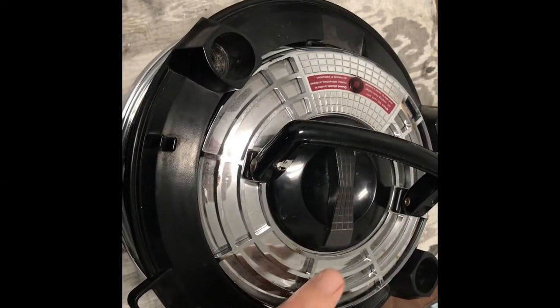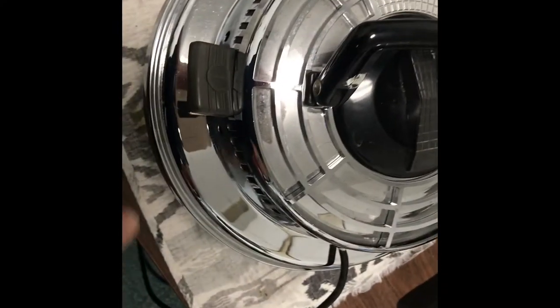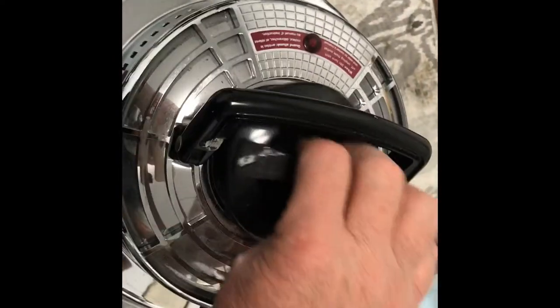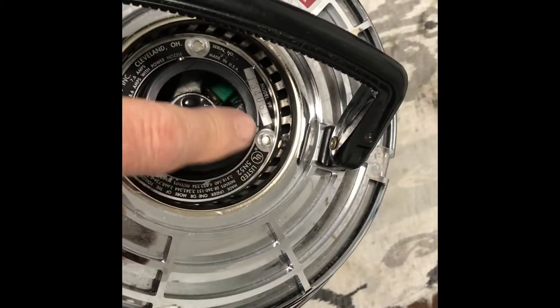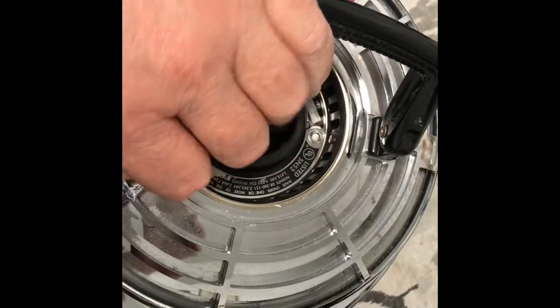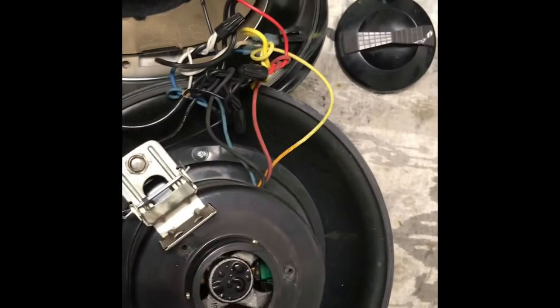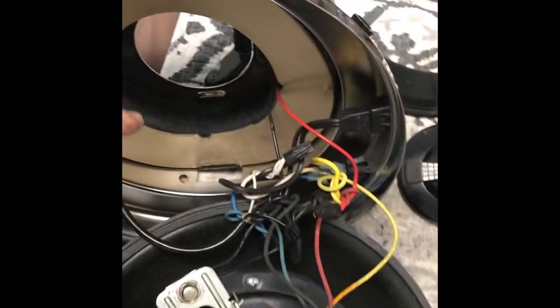What we're going to do with this 95X is take the tool caddy off and change the motor. You have to take the foot pedal pad off because we have to slide that through the housing. Take off the cap on the top — there are three screws in there that hold this together. I've already taken the screws out to save time. Take out that retainer and it'll come right out once you remove the screws. Grab the handle on the top and it should open up — you can't pull it straight up because it has all the wires.